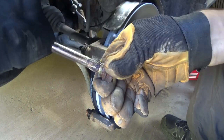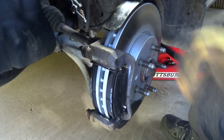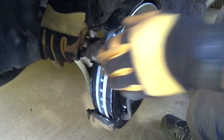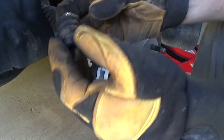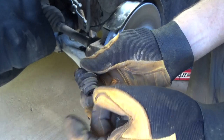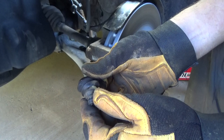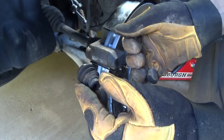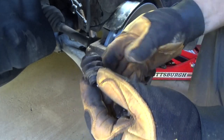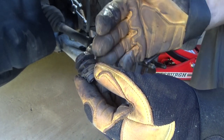These are the pins here and they pull right out. I may add a little more grease to the pins since we're replacing the boots anyway. The boots should just pull right out too. I don't think the boots were quite as bad as Devon thought — there are definitely no tears in them, but a lot of it is just that they didn't do a good job cleaning them up. It's a fairly inexpensive part; a bag of four is like seven bucks.